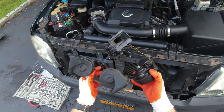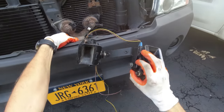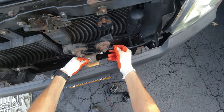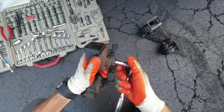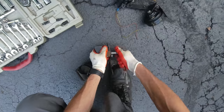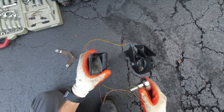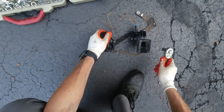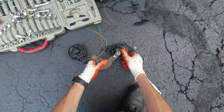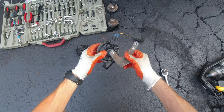I'm thinking I might reuse this bracket — take the new horns off their bracket and put them in here, then screw it to this metal bracket. This looks like a 10-millimeter socket so let's unscrew them. The holes here are much smaller than the hole for the horn itself, so I'm gonna have to make them bigger. I just pre-drilled these holes bigger with a regular drill and now they fit perfectly.